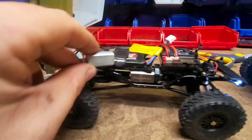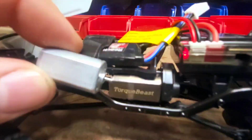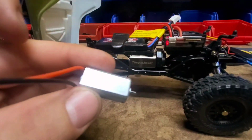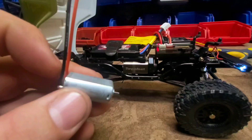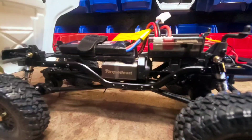That will be just the Torque Beast 2, or Torque Beast version 2 or something. Here's the original Torque Beast motor — you can see the difference in color. This is actually an electroplated black chrome on this new can, and it is a completely different motor on the inside. This one had solid carbon brushes, which worked really well, but they do tend to run kind of hot.